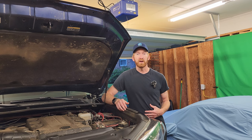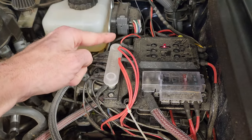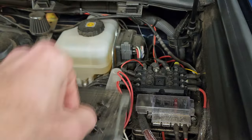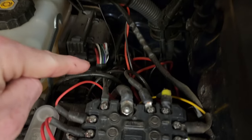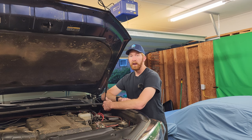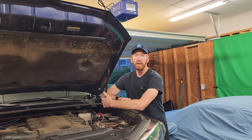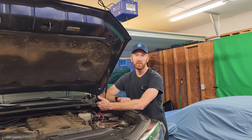First thing first, outside under the hood — you're going to be able to see that I have a separate fuse block wired here with a ground bar. Underneath the Garmin cover with it removed, you can see there are six circuits that wire up the lights, and a positive and a negative to power up the unit itself. Then there are these two other leads, and those are going to be for your control one and your control two. Whatever is powered up to those — when it sees a voltage signal — it's going to tell the app to turn on the lights that are programmed to it. The main idea from Garmin is, say it's speed sensitive or high beam sensitive: when you flash your high beams, it sees voltage and it'll turn on those auxiliary lights as well.